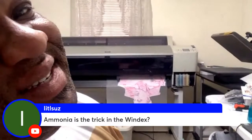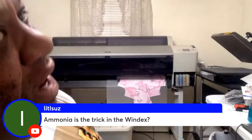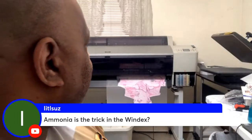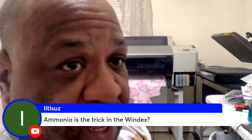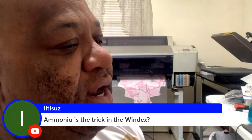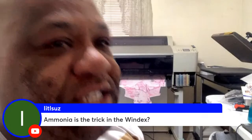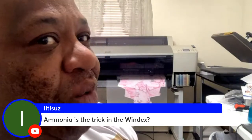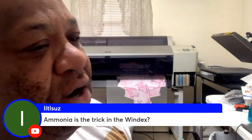He's saying ammonia is a trick with the Windex. That's pretty much what I use. But the only thing I don't like about that is, I know some people put it in their cartridges and do a head cleaning with it. And if you delaminate the head, like I did on a live a couple of days ago, I put it in the 1430 and it delaminated that head. For some people, it would scare the freaking bejesus out of them if they see that their printer ain't printing. So I don't want to scare people and do that. I don't like putting the ink cartridges in there.